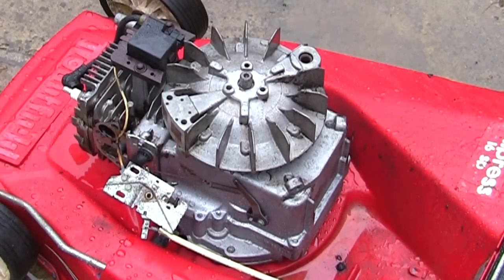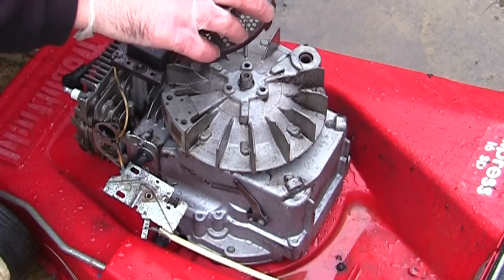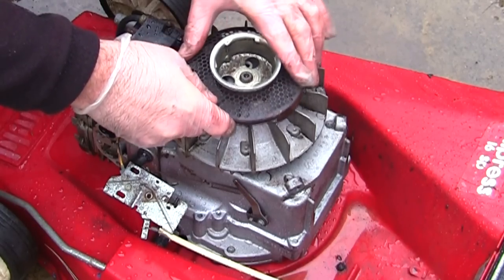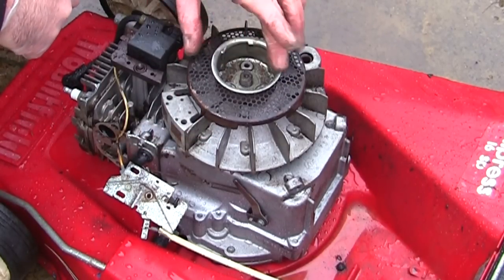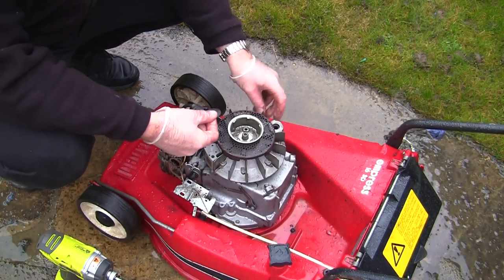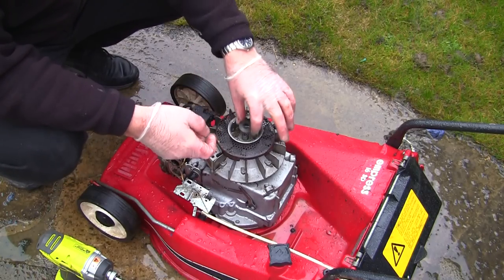I'm going to get the actual head again and this nut here. I'm going to pop this back on here. I'm going to tighten this back up. And that way I know everything's alright, I know all the flywheel keys are alright. Never ever hit the top of the crank, by the way, trying to get this actual flywheel off, because you will actually hurt the threads in here, and this will never rebolt back on.